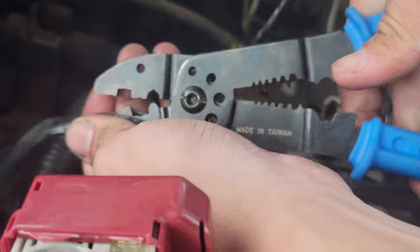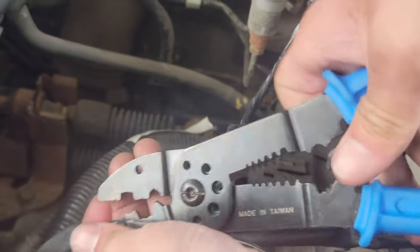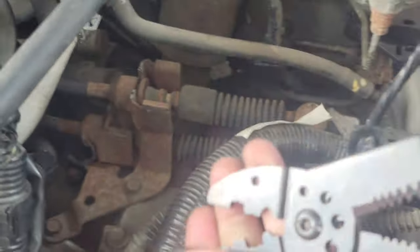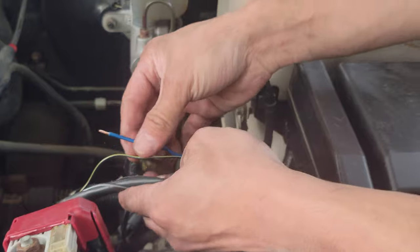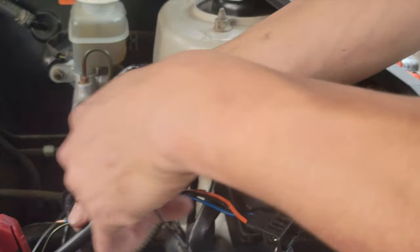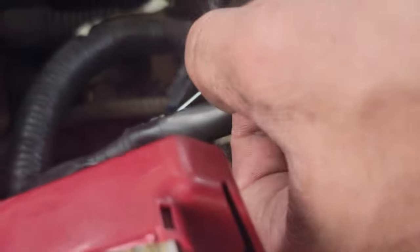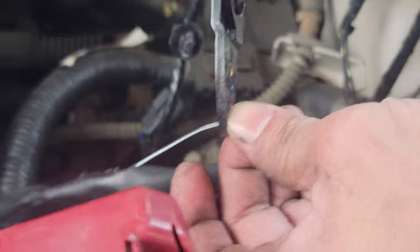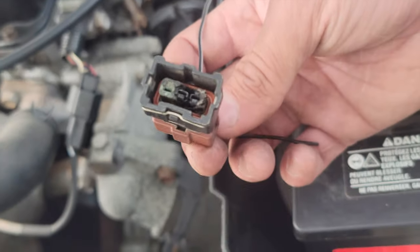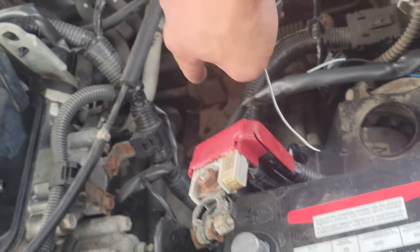So we're gonna have to cut the electrical tape we just put on. Make sure you don't cut any of the wires. Pull it up to the end here — looks like we're gonna be cutting around here. Cut the last wire. This is our garbage — this is what made our speedometer and odometer not work. But there's also a speed sensor in there that we gotta replace.